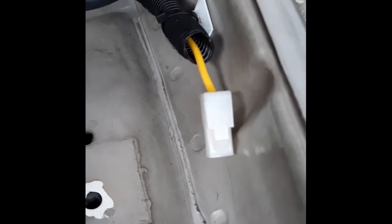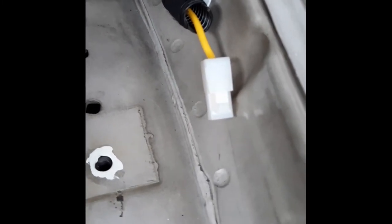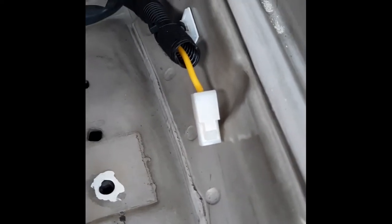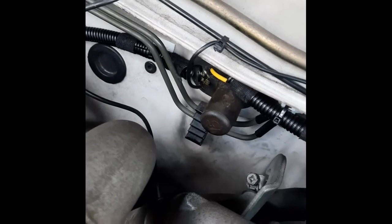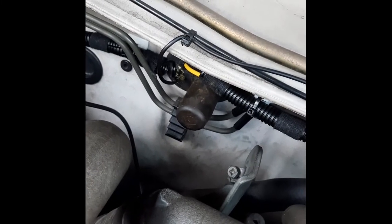Okay, I've finally done the trunking for the power cable that will activate the relay to the fan. So it's going here, and as you can see, I solder the connector here and leave it like that. It's safe because it won't contact anything, and I've cable tied all this in place. And don't forget, you need to tape the trunking, otherwise it will open up and the wires will come out. You can see the wires a little exposed there, but never mind, because it cannot come out since I taped it up. Alright, and don't forget to put some silicone on the grommet over here where the wires are coming out. We don't want any water coming in.